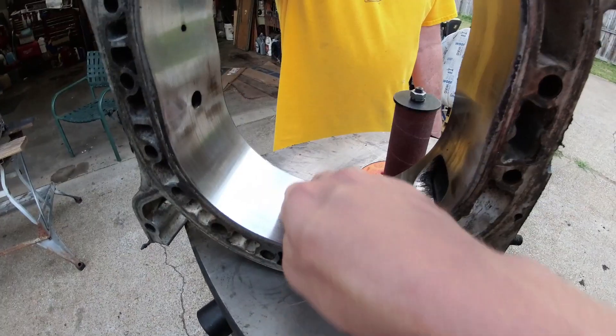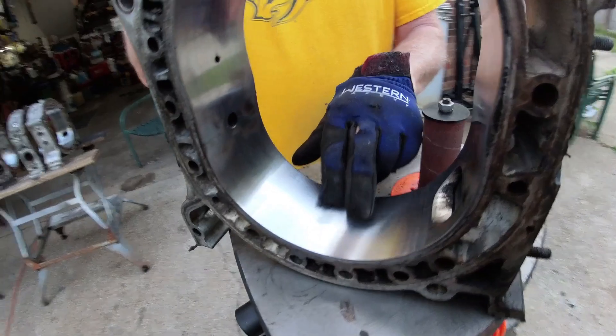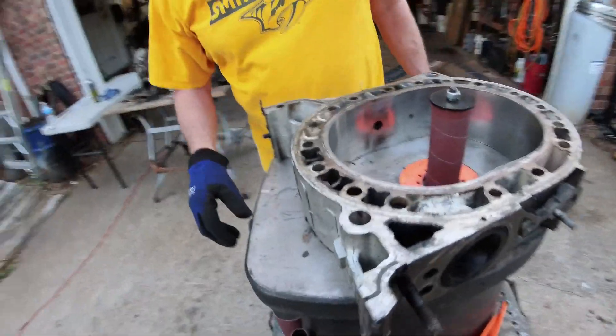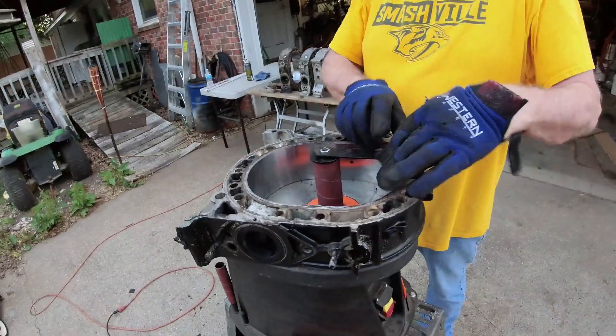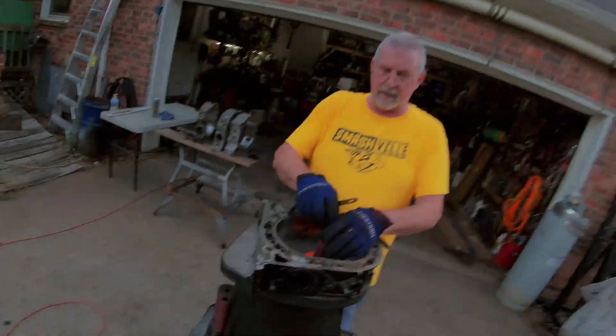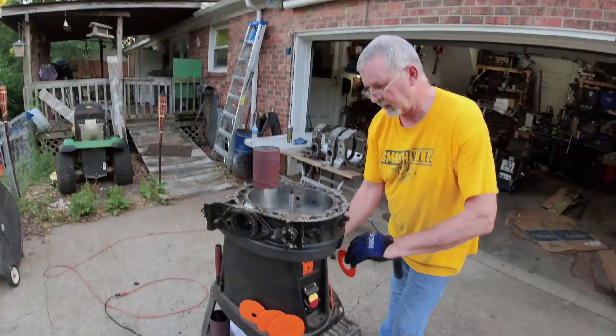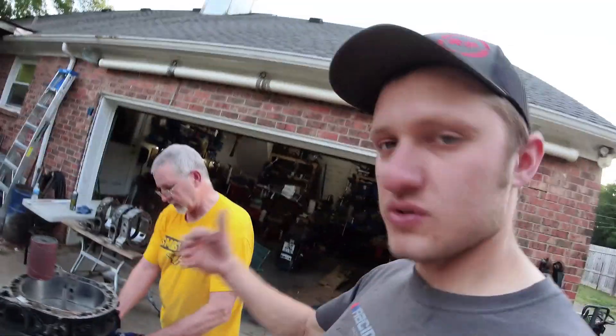It's definitely better, but you can still feel the unevenness of that surface. It's definitely making it much more usable. I'm going to change the drum back out. I'd be curious — you know, you can hone a cylinder a pretty good bit — if you sat on it and really dug in what it would do. You don't want to take this coating all the way off, but it is reasonably thick. That coating is what protects the housing from getting chewed up by the apex seal.